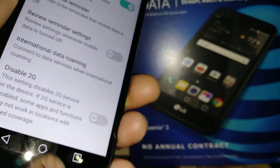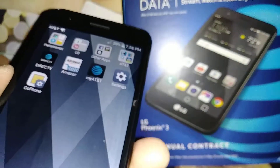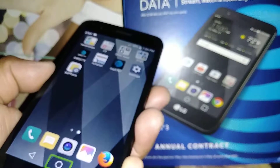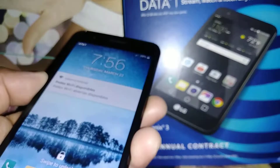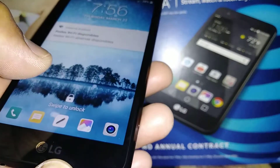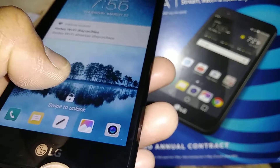We're on the main screen. I'm going to show you how to unlock the screen. Let's turn the screen off, then turn it back on and wait about 10 to 15 seconds for the lock screen to activate. To unlock with TalkBack, on some phones you touch the lock screen and a green square appears around the lock icon — highlight it and double tap.